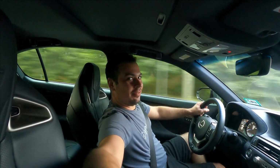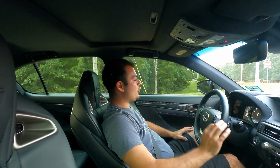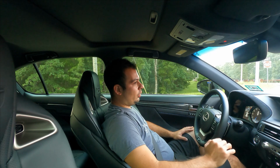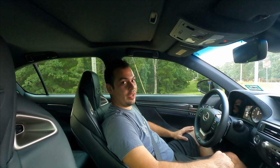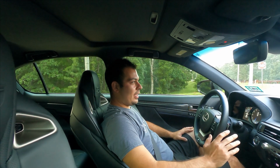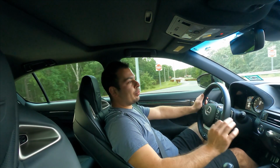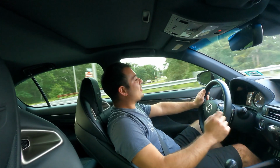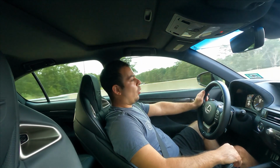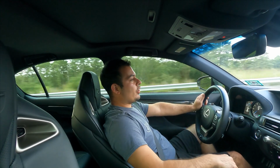It will never fail. Now, one thing I want to touch on with this car is Toyota's dual stage cold air intake setup. I did a ton of research because I wanted to do a cold air intake on this, and I actually talked to the guys over at RR Racing. And they informed me that Toyota and Lexus designed this airbox so well that they could not do anything with it to improve horsepower or flow. And the last thing that they wanted to do was design a system that's going to cost you power. So all that they have you change is the air hose that goes from the throttle body to the airbox.